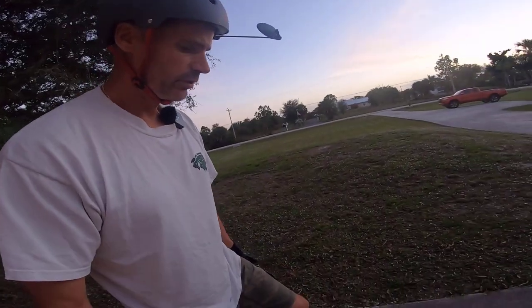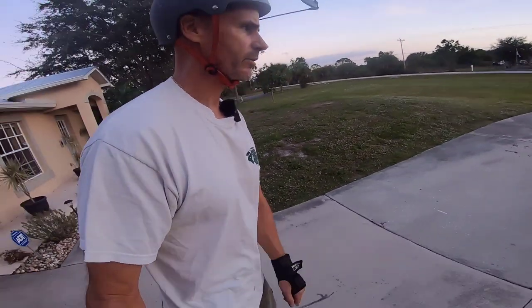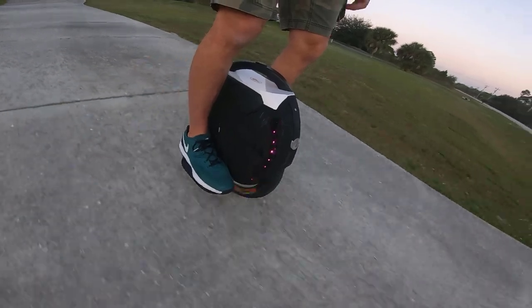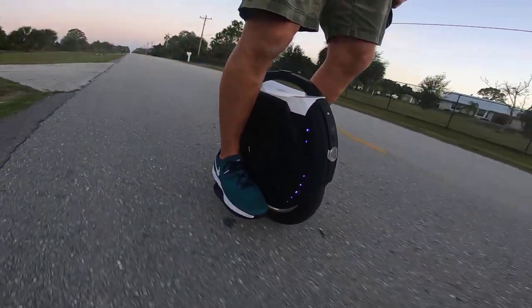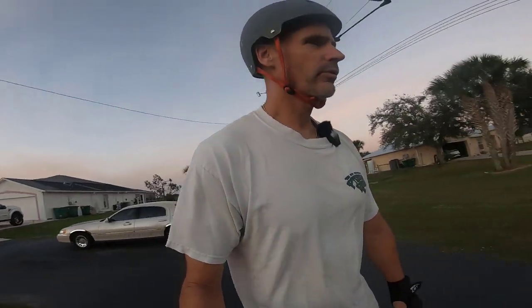All right, so just like you always do with KingSong firmware, after you apply the firmware, you have to do the horizontal calibration. I did that. So we're going to see how this feels. It works. That's a nice thing, huh? I'm just curious if I'll feel a seat of the pants difference. Please decelerate. Whoa, that's a difference. I wonder if my thresholds got all reset with the new firmware. That's what it feels like.